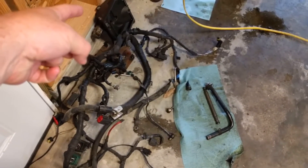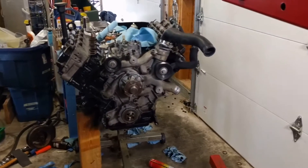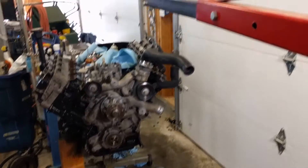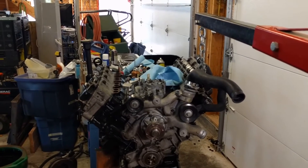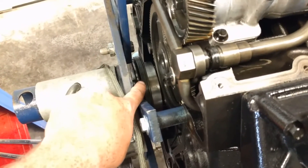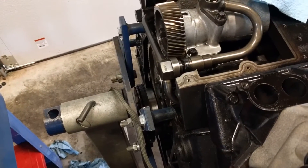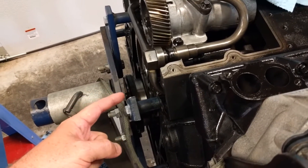So the remaining task list is: wire harness, high pressure oil pump cover, engine mounts, regulated fuel return lines. Then we'll be ready to drop it back in. Today's plan is to get it off the stand onto the engine hoist, get the whole back cleaned and prepped. To do that prep I also need to get that rear seal and the dust cover plate off, then put the new seal on with the special Freedom Racing tool.